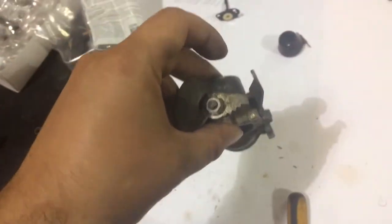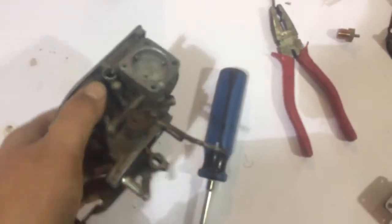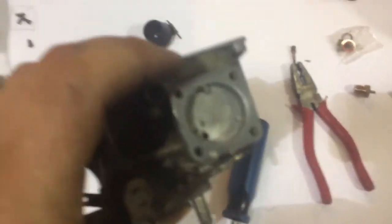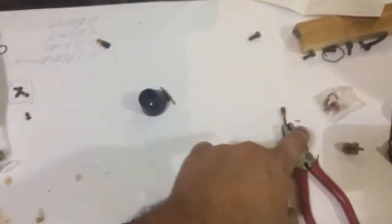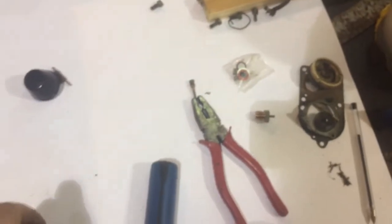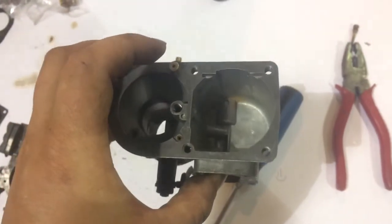As soon as my phone dies, all my help's gone. With all these bits it's a bit intimidating, and I don't have them all labeled this time. But the first couple times I ever did this, and when I rebuild a carburetor I've never done before, I like to take it apart and lay the bits out — every piece I take out, I'll label it whatever I think it is. You don't need to know what every part does to rebuild it, because a lot of times you're just replacing the old ones that came out. But anywhere that fuel or air may go, you want to spray out and clean.